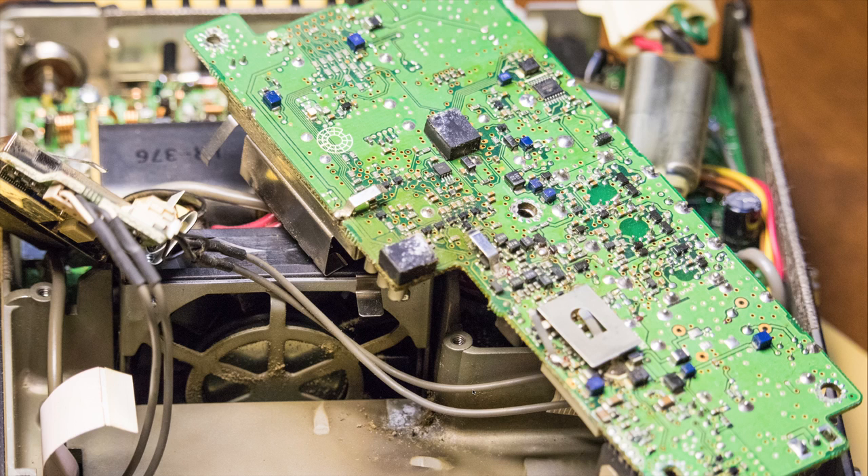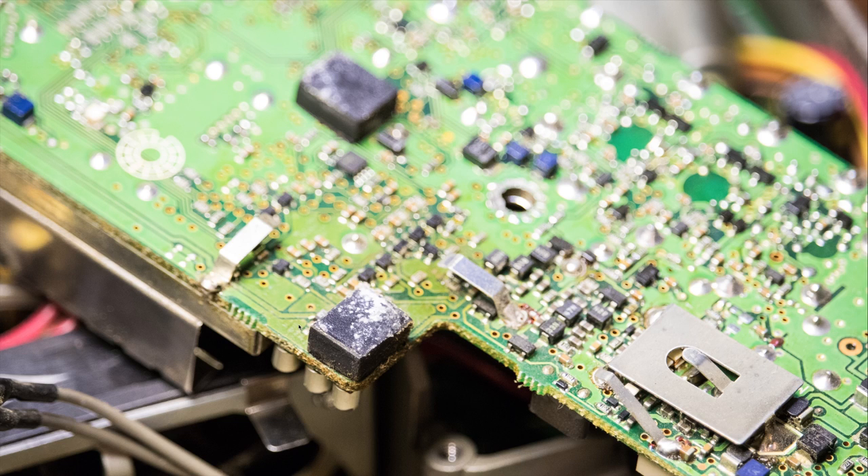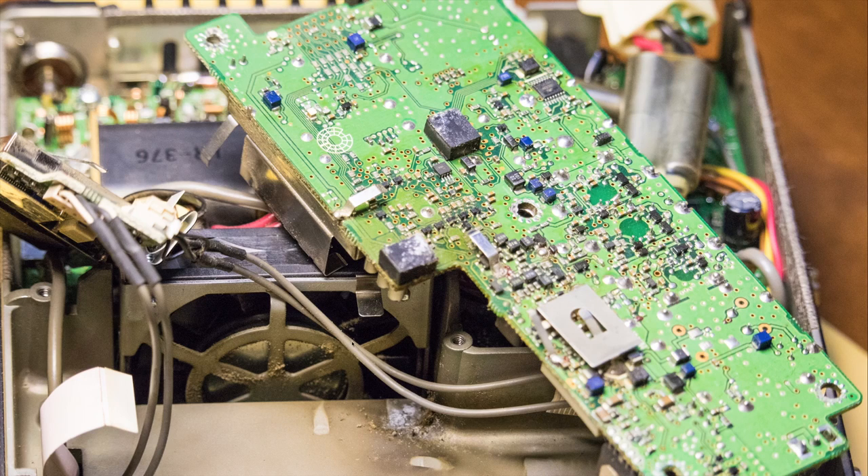Here's a closer picture of it. What you have to do is take this rubber pad completely off — the problem was right here. I didn't glue it back on directly. What I did was put some epoxy on the bottom of this rubber pad and glued it back in. Then I took the thinnest piece of plastic I could find and glued it to the top — that's to insulate the rubber from the board so they're not contacting each other again. That's my personal fix; I don't know if it's ideal but that's what I did.